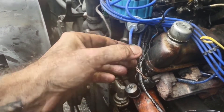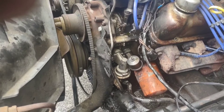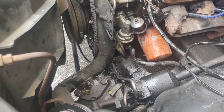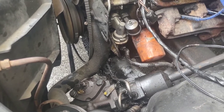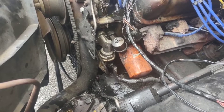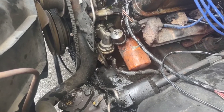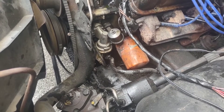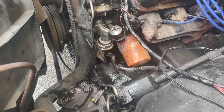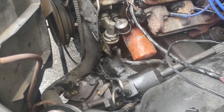It's not as spongy as it's supposed to be, so we're going to go fetch ourselves a new hose and some new clamps. We're going to be connecting back into the wannabe cooler that Ford puts in these F-150s for the power steering system and dropping the pump back in. It's a dirty greasy filthy mess underneath here, but this is a work truck — it goes to work every single day and we bought it for under a thousand dollars. Once we get our piece of hose we'll get back to you and give you a rough-in on how to put this thing all back together.